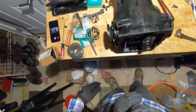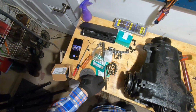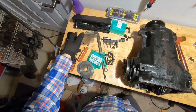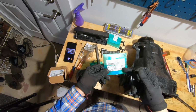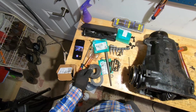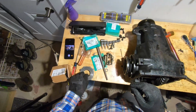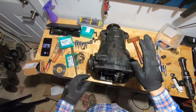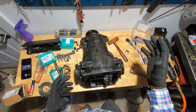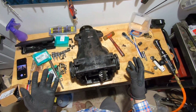So, just to recap, those cover bolts, replace them brand new with these guys. And then get yourself some 2.1 millimeter Porsche dog ear plates, OEM clutches, get a set of 3. It's not cheap, but it's a lot cheaper than a fully rebuilt diff. Again, if you don't have a lot of play in your diff, if it's not making noise, and it's not leaking, you don't have to do too much else.